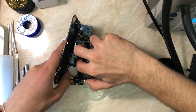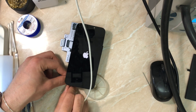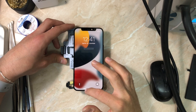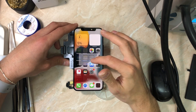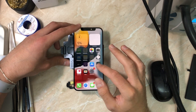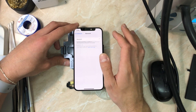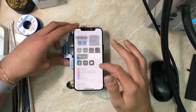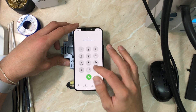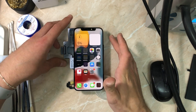This is a 4-in-1 board tester for iPhone 12 series. Don't forget to connect the upper flex so you will have functional backlight — without it you'll only have minimum backlight and cannot turn it up. As you can see, we have our Wi-Fi and our Bluetooth. Let's go to settings and check if everything is okay. I didn't connect the Wi-Fi antenna so we won't have a network, but in About we can see the modem firmware. Yep, everything is okay.